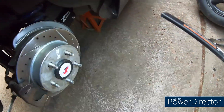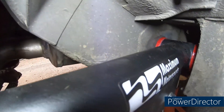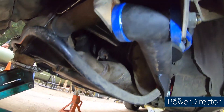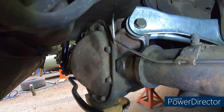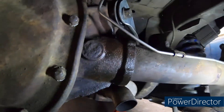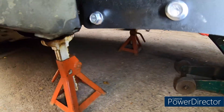Take a look at the finished product. We got these Maximum Motorsports heavy-duty control arms in - nice bushings all the way, spherical bushings solid in the rear, and polyurethane in the front. Got the new arms torqued down, pretty dialed. Just gotta set it down and get the sway bar in - it's a wrap.